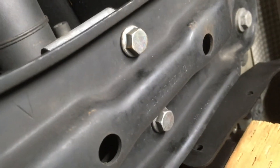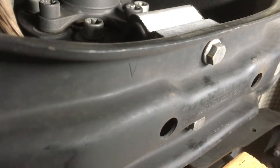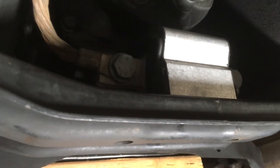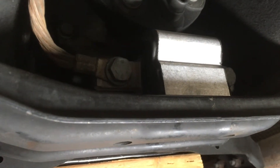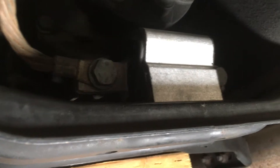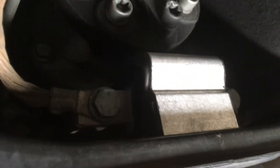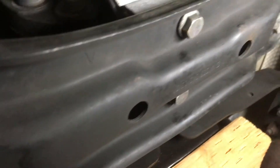There are two bigger bolts on each side — 16 millimeter — and then there are two 13 millimeter bolts. You want to support the transmission just a little bit, take those two bolts out, then lift it up a little bit more and take out the two 16 millimeter bolts. After that, slide your new one in — mine has a ground wire, so make sure that goes in the same spot. The 16 millimeter bolts are torqued to 45–50 newton meters and the 13 millimeter bolts to 25 newton meters. Lower the transmission back down, make sure your holes align, put those in, and torque them down.